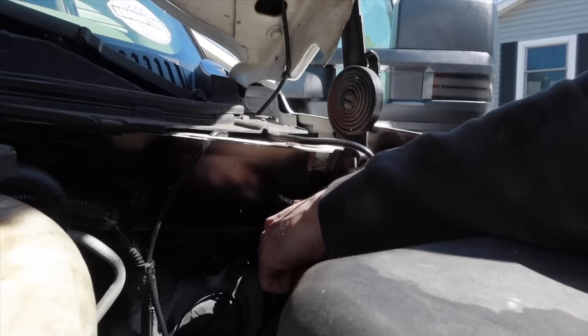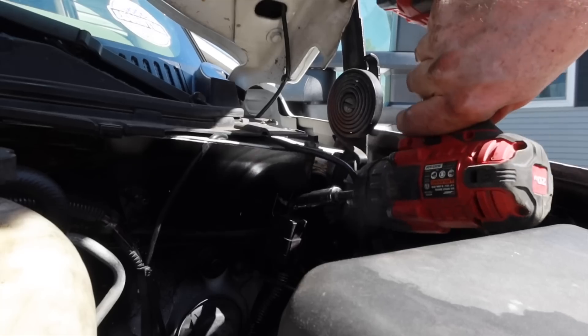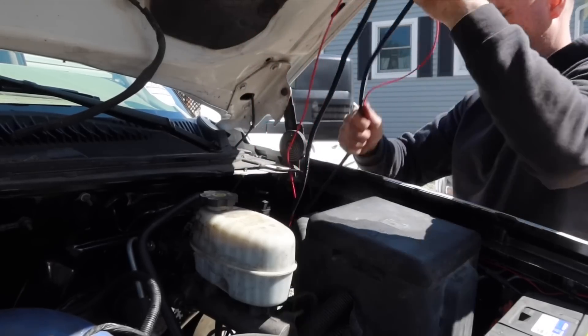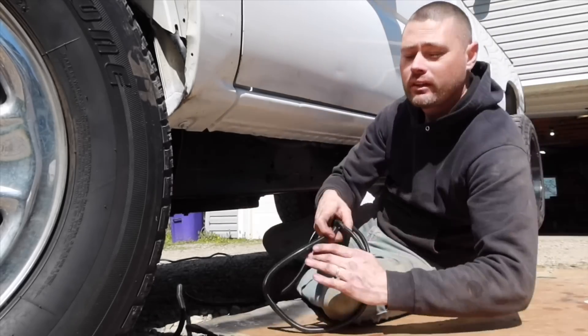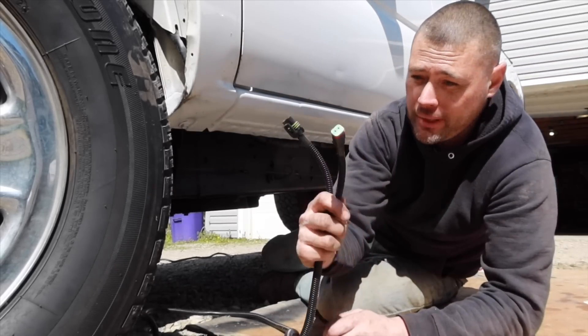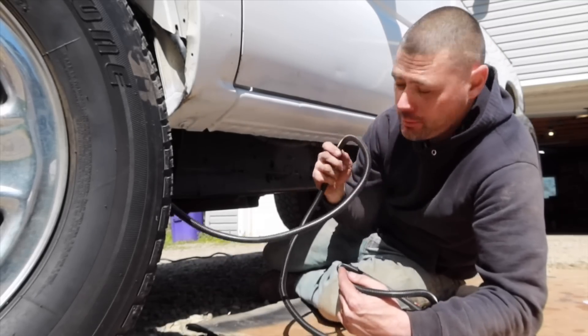This is my relay — I'm going to mount it right there on the side. Next we're going to route these two connections straight to the lift pump. It's just plug and play, very simple. I'm going to route this wire right through the frame rail.